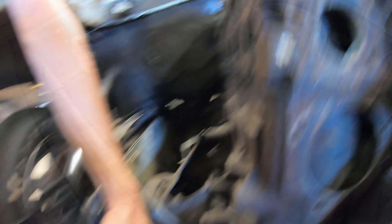I marked where the bell housing bolts are, just general areas so I know what I'm looking at. These are the factory engine mounts for a '77 Pinto — I found these on tbirdcougarparts.com. They're adjustable side to side, so maybe I can use the different hole pattern; these look super nice and pretty robust. I'm going to pull the front clip off, pull the bumper off, lower it down on the jack stands, get the engine out, then put another engine in that's already got a V8 bell housing on it.